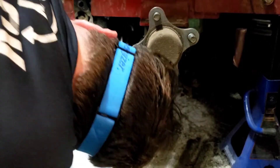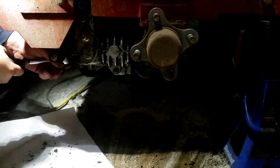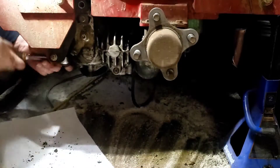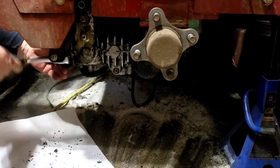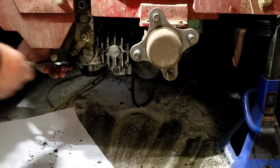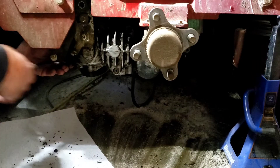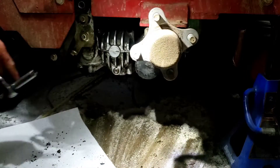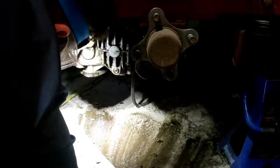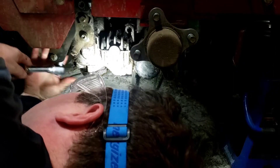So I have another one right there behind there. And you can get it like this if you've got the extender and a deep well. The other thing you're going to have to do is remove the tension on the hydraulic transmission belt. Luckily for me, except for the cost, the belt broke the last time I used it. I said I was using it while it was leaking, and I just kept refilling it.